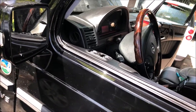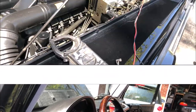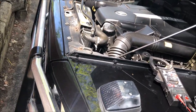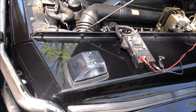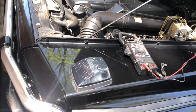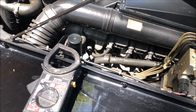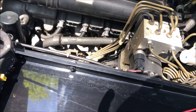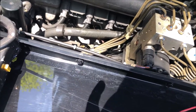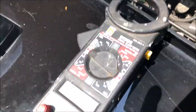I'm going to leave it running for a minute. Before I check the battery — which is very unlikely to be the cause right now — there's one more thing I want to test: rev up the engine while checking the voltage. If I rev it up, the alternator should produce more voltage. Right now we're at 10 volts, which it shouldn't be. I'm going to rev the engine by hand.